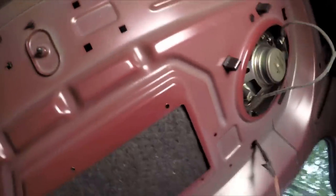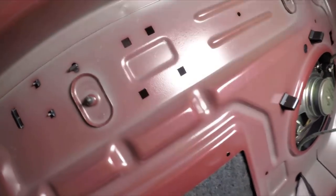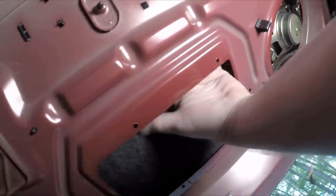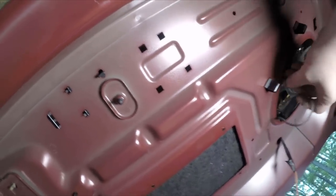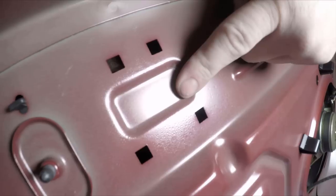Next you're going to need to get into the trunk and look up this way — you'll need a light. From inside the trunk looking up, you'll see an empty place where something should be. That's where your compass sensor goes. If you don't have the Monsoon audio, the easiest way to reach it is through the hole where the amp would be, because you can reach straight forward and feel around for what you need. Then all you need to do is snap the compass sensor in — it just clips in like this, and the wiring is up there too; you'll just have to feel for it and reconnect it. That will take care of the compass end of getting the thing to work.